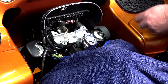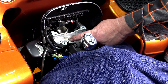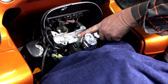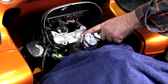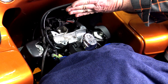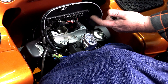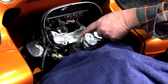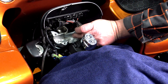Whatever bars you're getting ready to install, look on the bottom and see if there's a small hole drilled to the side of where your wires came through. If there's not, you need to knock this pin down. This pin on the stock bars goes into a small hole in the bars and puts them exactly where they need to be — so you have no control over up or down positioning. Most aftermarket bars do not have that hole, so just drive that pin down flush.